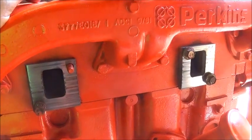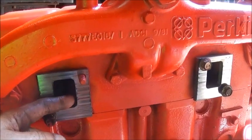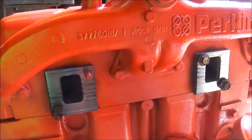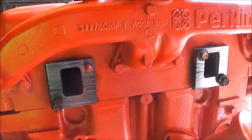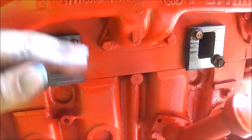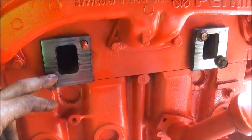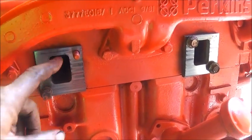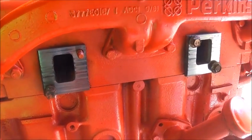We'll go ahead and I think what I'll do is make two plates that go on the inside of these flanges, and they're gonna be solid pieces of probably flashing, and we'll screw them on there, and I'll cover my intake good, and that way we can put our piece up and tack weld it where we want it with these flanges on, because I don't want to take any chances on getting any slag or anything down into the exhaust manifold.